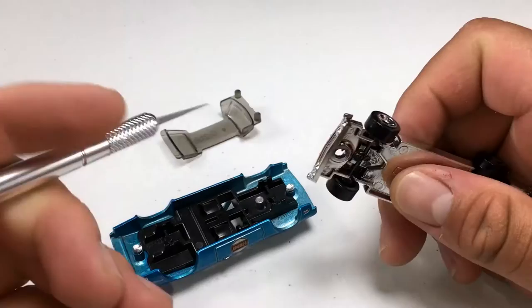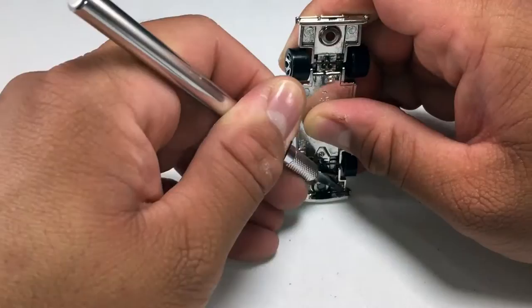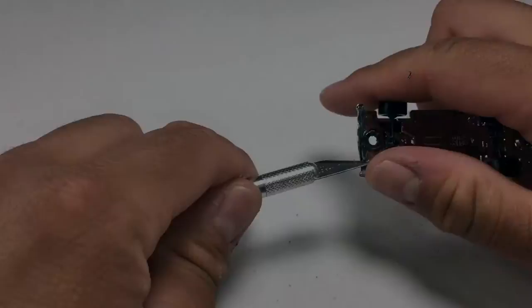We will mark it right here — I think that'll be short enough to accomplish the task. We also have to remove the grill so we can place the opener up front. We can do that by scoring the plastic over and over and then breaking it off with some pliers.